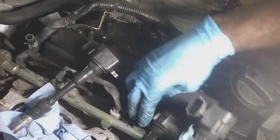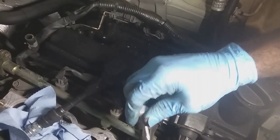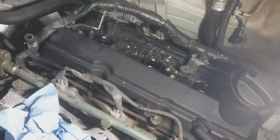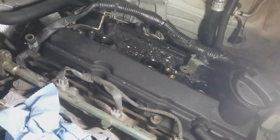One more thing, I'm gonna mark my coils here. So I got little dots here indicating the corresponding cylinder. So we got 2, 4, and we got 6 here. And I'm gonna put a mark on the bad coil boot so we know which one to change. So I'm gonna mix all this stuff up here. Even though we didn't have a cylinder misfire, like it didn't specify the cylinder, I'm still going to put everything back in its corresponding location and show you what's going on.